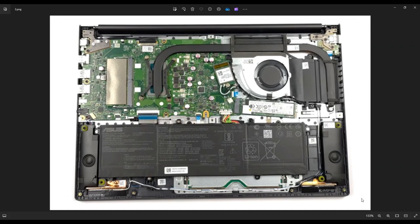One thing I do before touching anything in a computer is either remove or at least unplug the battery. A computer is safer to work on when as little power as possible is running through it. Here's your battery right here along the bottom. To get this battery out, there are four screws and it's plugged into the motherboard right here. There's a metal part on top that holds down the plastic plug — you're going to slide that metal part up to free it, then snap it right off the motherboard. This is a 42 watt-hour battery, 11.55 volt, and the ASUS battery model number is C31N2201. I'll have that information and replacement options below in the description.